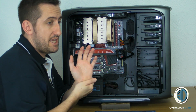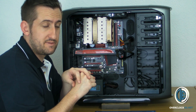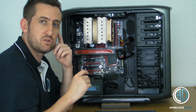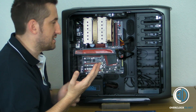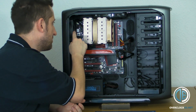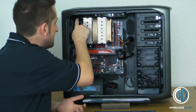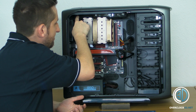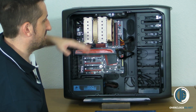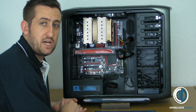Now, what I need to explain to you is the 240mm radiator. For me, that would be for a CPU or a hot graphics card. If you had a much smaller graphics card, then you could get away with running the pair, but I wouldn't recommend it. So what I'm trying to explain is, if you had a 240mm radiator, you couldn't have a big heatsink, you couldn't run an H70, so what are you meant to use? Because with a decent thickness water cooling radiator, it's going to come down probably 30, 40, maybe even 50mm from the roof, which is going to cut off where your heatsink would be. So it all starts to get very, very complicated, and although it does support water, it's not as straightforward as you'd think.